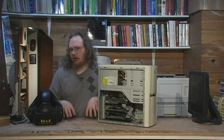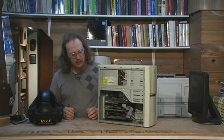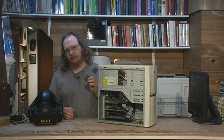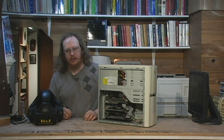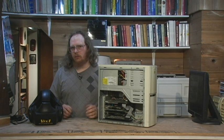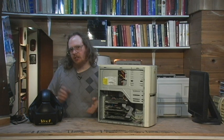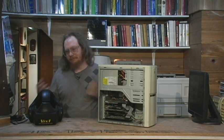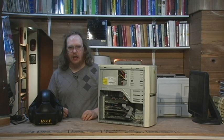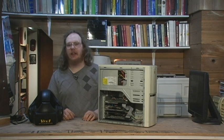Electrically, protocol-wise, it's not always the same. As a result, I've had to go through a ton of video cards before I finally found one which was moderately good. This one in here right now is an 8 megabyte ATI All-in-Wonder. So that's working. And how do I know it's working? Because when the driver loads, I actually see something on the headgear unit itself. Fancy, imagine that. Non-compatible devices, you'll just simply see no video. Go to the next video card.